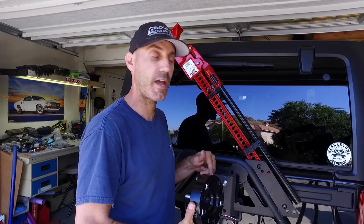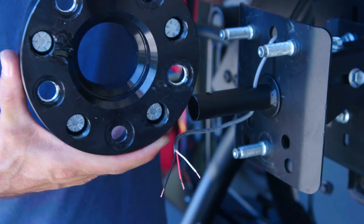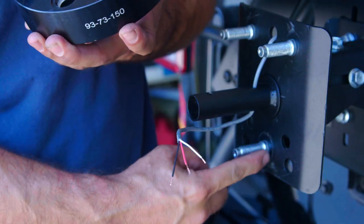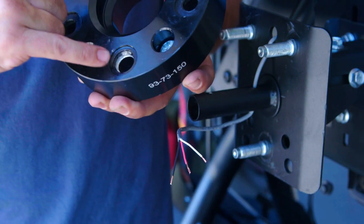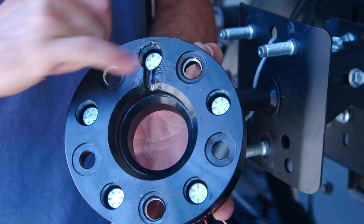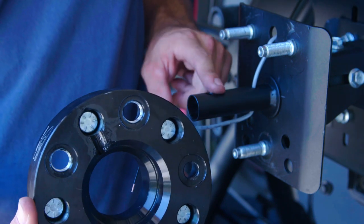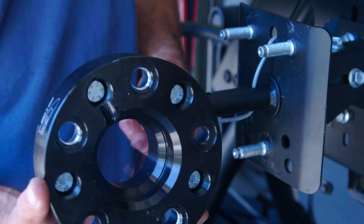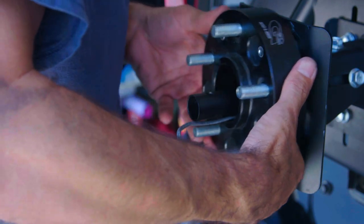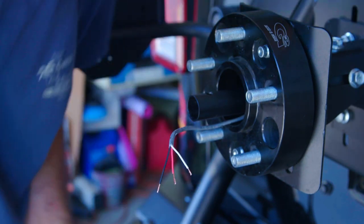This is the wheel spacer — it's an inch and a half — to adapt the stock rim with the 37-inch tire onto this mounting bracket. I had to make a couple of quick changes: because of the shoulders on the mounting plate and where the studs come through, I did a little clearance work on the three holes for the lugs, and then I made a small channel for the wire that's going to come out through this hole and go down into the center post for the brake light and license plate kit. It now goes on just like that, the wire has its nice little home, and sits flush.